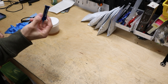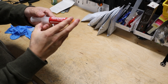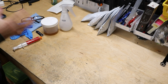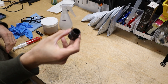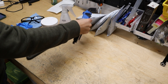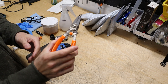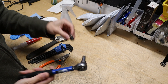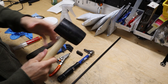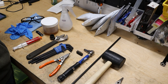And then for the heavy, I'm going to use a little bit of this Fox float fluid, which is a little bit thicker and should help stick a little bit better to the upper part of the air spring. You also want some grease for the seals — the recommendation is to use SRAM Butter. It's also really handy to have some isopropyl alcohol to keep things nice and clean as you go. Now for tools to remove the air spring top cap, sometimes it'll call for a cassette tool, but in my case there's no cassette interface so I just use an adjustable wrench. Some other basic tools you need are a set of Allen wrenches — specifically 2.5, 5, and 8 millimeters — snap ring pliers to remove the retaining ring at the bottom of the air spring, some hex bits and a torque wrench, some type of stick or wooden dowel when it's time to re-grease, a rubber mallet to dislodge the bottoms of the spring and the damper from the lowers, and you may or may not need some needle nose pliers and a flat blade screwdriver as well.